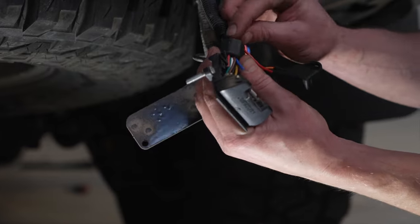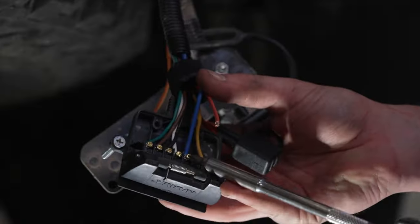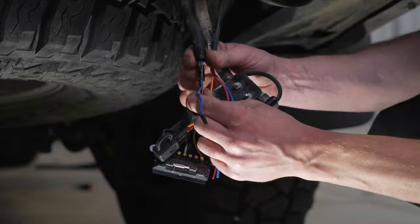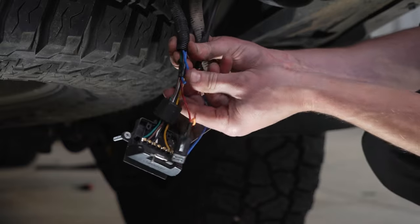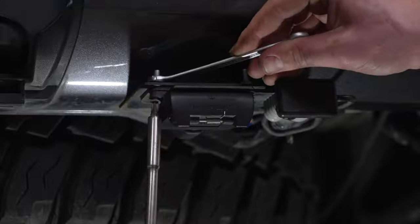Feed both the exposed red and blue wires at the end of the main cable into the trailer socket and connect the blue wire to pin number 5. Connect the red wire to pin number 6. If there is a blue wire already fitted to pin number 5, pull this back outside the connector and tape it back, ensuring it is insulated and sealed. Refit the trailer base cover and remount to the vehicle.